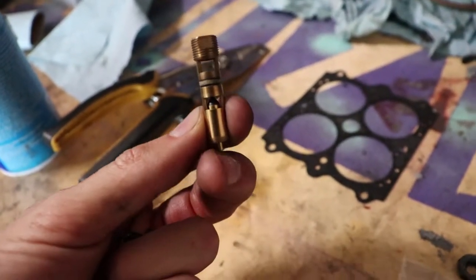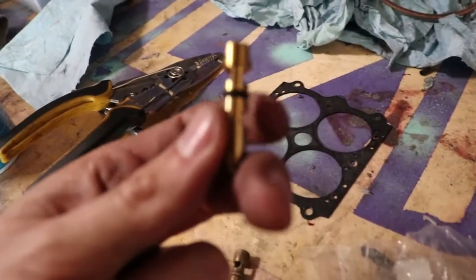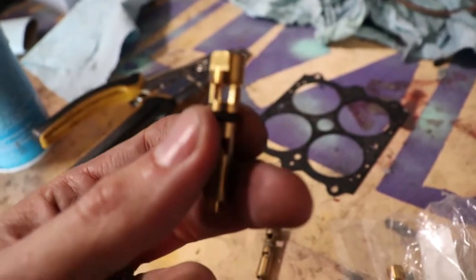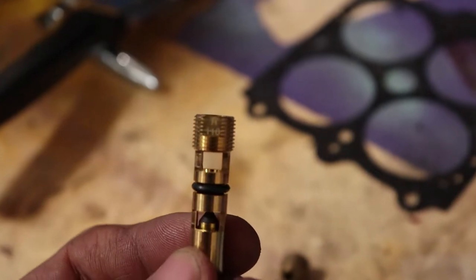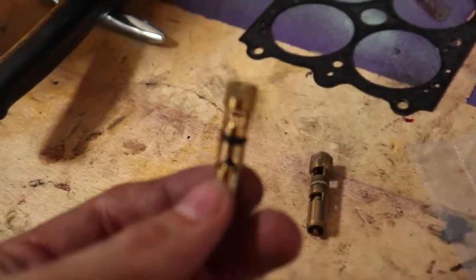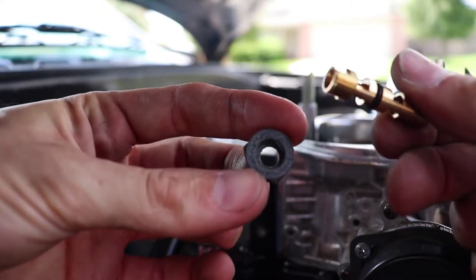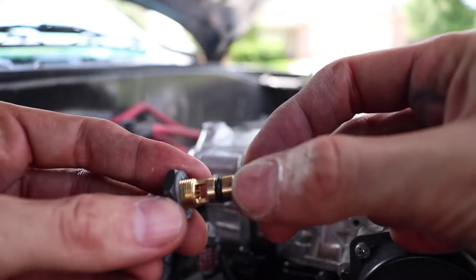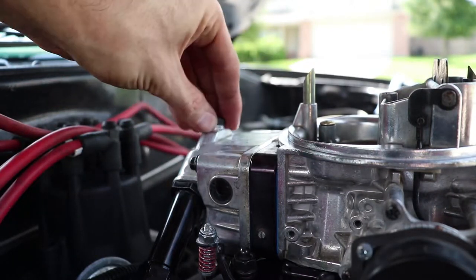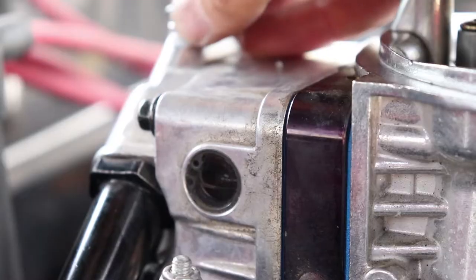Here's my old one — you can see that o-ring has seen better days. The actual port looks clean, not dirty. These are the brand new ones — you can see that o-ring is in way better shape. To find the right number, it's listed right up here — it's a 110, which is exactly what mine is, so we know this is the right one. These are very easy to replace: it's just a notched nut with two little gaskets. You pop it in and use that nut to tighten it down, then use this to lock it in place.